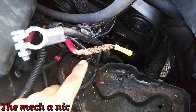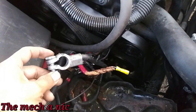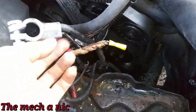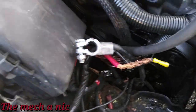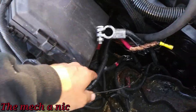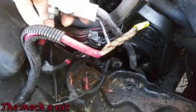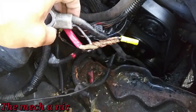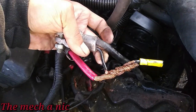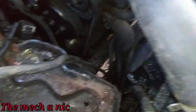It's the next day and I'm messing with this Impala again. I took all the electrical tape off and look at something really messed up — this one they replaced goes all the way down to the starter, but the other end only has this thin gauge wire hanging off of it. What they did is tied the fuse box harness — which is a heavy duty gauge — into that skimpy little wire. You can't do that. There's a reason why the wire going to the fuse box is such a heavy duty gauge.